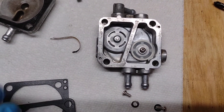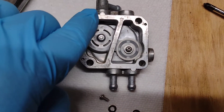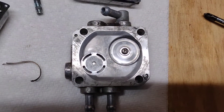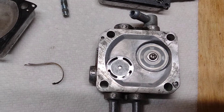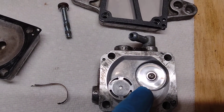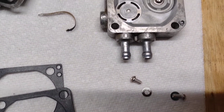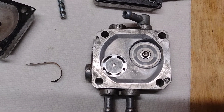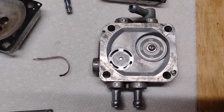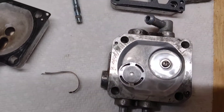I just finished removing the gaskets and cleaning up the center section of the pump. Good thing about this section is it's just a smooth face where the gasket goes - it doesn't have that ridge bump, so it's easier to clean up. Mainly just used a straight blade razor and then a little bit of scotch-brite. I did remove and replace the one-way valve discs, but ended up using the same hardware even though the kit came with replacements, since everything looked good and I didn't want to risk threading issues.